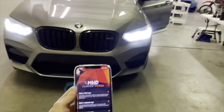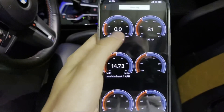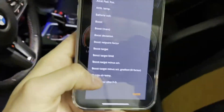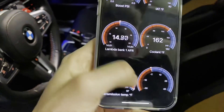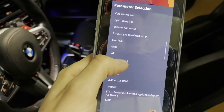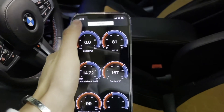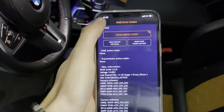There are a lot of options here — I now have data logging available. I can edit and choose whichever parameters I like, for example coolant, lambda which is your AFRs, transmission temp, and there are quite a few more options than I had on my E82s or E92s. We already have IAT in there. You've got boost, IAT, AFR, coolant, and transmission temp. You can enable auto logging, and you can also go to codes to read or clear DME codes on the fly while driving if you keep the adapter connected.